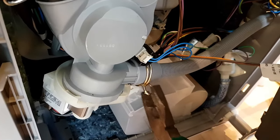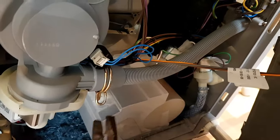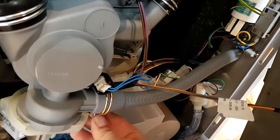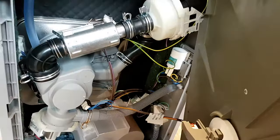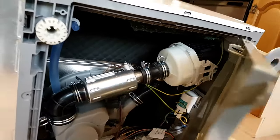I've got the pliers on the clamp and I'm just putting it onto the pump. I'm going to turn this bit around just so it doesn't foul the base of the unit once I put that back on, then clamp it and push it round. The clamp clip is now well out of the way, ready for replacing the base of the unit. We can now replace the base, which on this model has some slots on the back that just slot into the holes, and then it clips in by pushing around the circumference where the clips are placed — and that's that fitted.